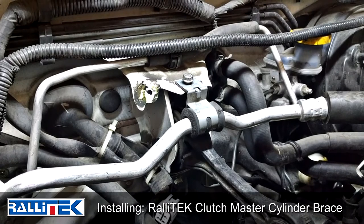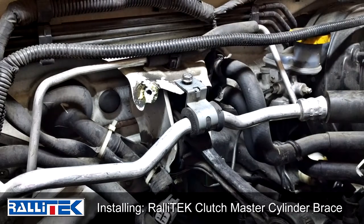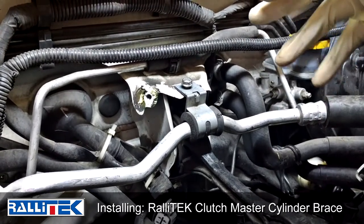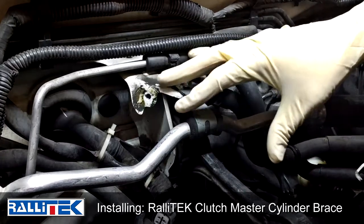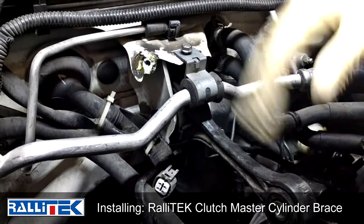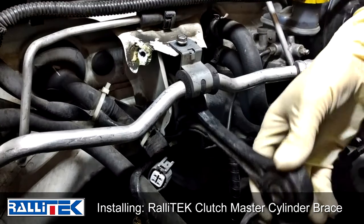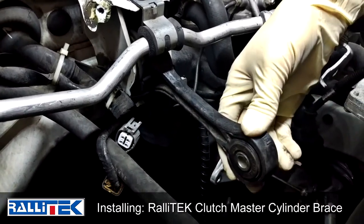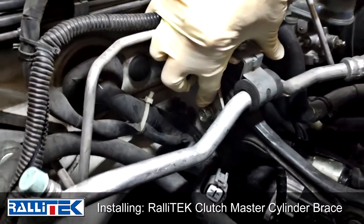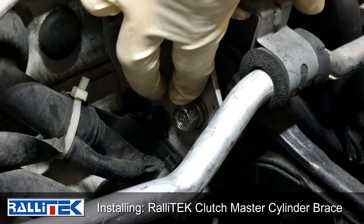This car is equipped with a front mount intercooler — the top mount is no longer in this area. If you do have a top mount, you're gonna have to get that pulled out before you start the install, so you can gain better access to this area back here. The transmission has already been pulled on this car for a clutch job, so you don't have to pull the transmission. But you're gonna have this pitch stop connected to the transmission, and the first bolt you'll need to remove is this bolt on the back where the pitch stop is mounted to the firewall.